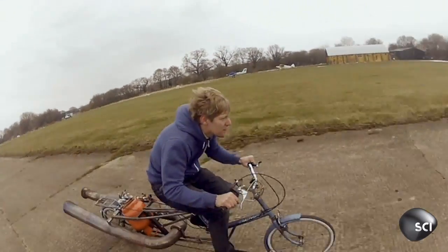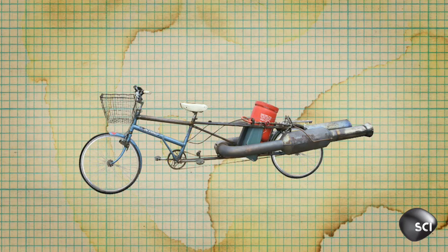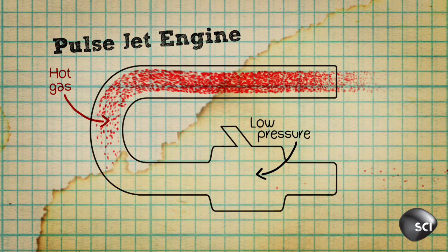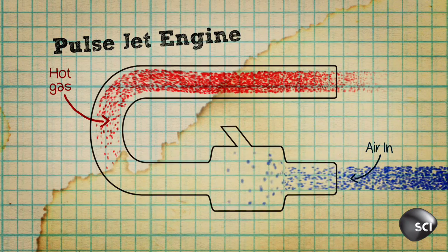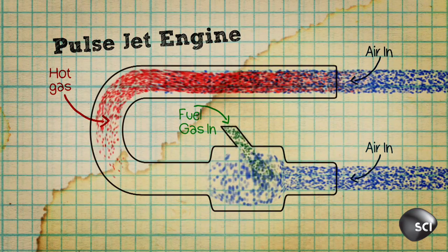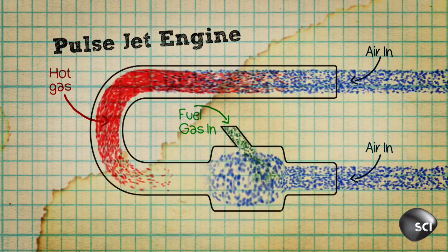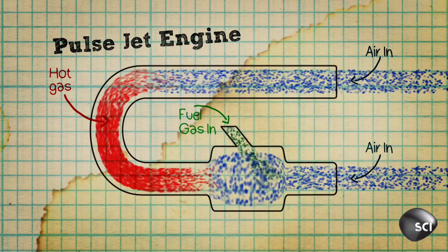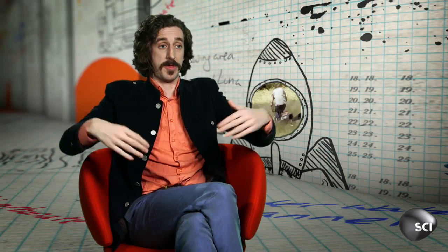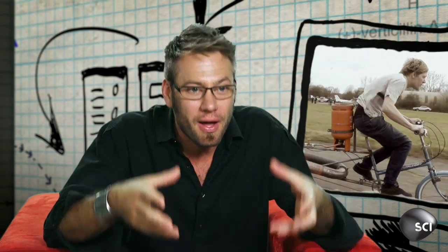But no one's trailing with a leaf blower — what's going on? Whenever the fuel combusts, it expands rapidly. But after it's burnt all the fuel, it goes so far it actually creates a low pressure in the combustion chamber. This means air from the air inlet is going to get sucked in, gas is going to be allowed in from its throttle control, and air is also going to be sucked back by the exhaust pipe. However, since the exhaust pipe is a bit longer, some of those hot combusted gases are still trapped in that pipe, so when they come back, they're still hot. They will fire the next one, and you just get this continuous rolling combustion which gives the jet the thrust. These explosions are happening 250 times a second, and they're loud explosions — so it's loud, it's powerful, it's cool.